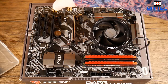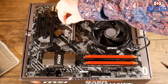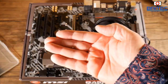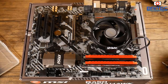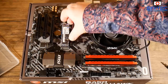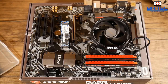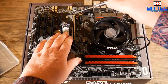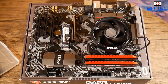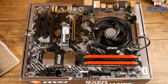Let's get back to the build. We're going to put in the drive for the Windows operating system. Taking out the screw from the board — this M.2 slot comes in two parts. I do like these MSI Tomahawk motherboards. I'll put the M.2 drive into its location and then put the little screw back on top. Having a magnetic screwdriver here is very useful because these screws are so small. There we go — that's done, and that's for our Windows installation. Now this is ready to go into the case.